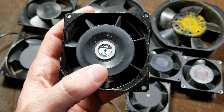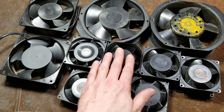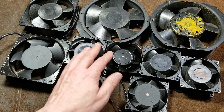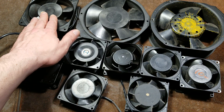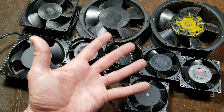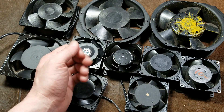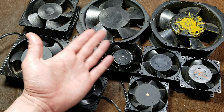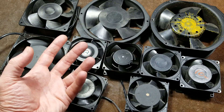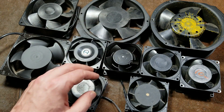Unfortunately, that action is quite weak on the smaller sizes. You'll notice on this table that all these fans have hub motors that reach a minimum size on these 80 millimeter fans — it's a big motor with just a little bit of blades, and the hub size only increases slightly when you get to the 120s or these 150 millimeter fans, because as you get more and more physical size, the efficiency and amount of power you can deliver goes up proportionately as well.